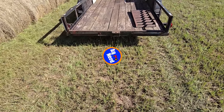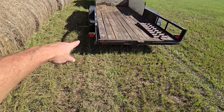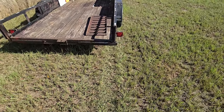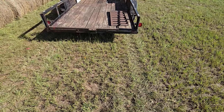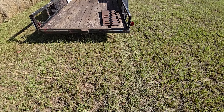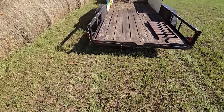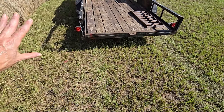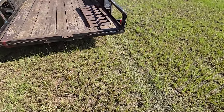Let's test our lights. I turned the flashers on, and as you can see, they're working here and they're working there. There are a couple of functions I do to test the lights. I'll put on the hazard lights — not only does that work for your hazards, but it can also simulate your left turn and right turn since it uses the same wire with just a different function on the vehicle. If you have flashers working, you're in good shape. Also turn on your parking lights and make sure your running light is working.